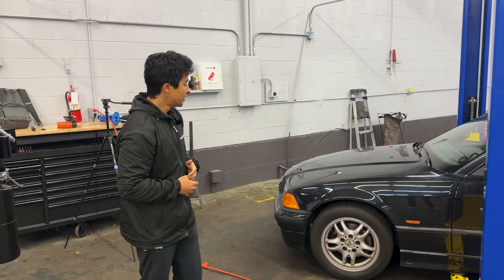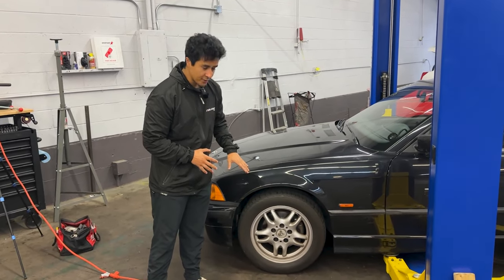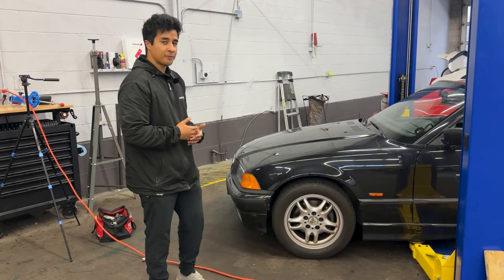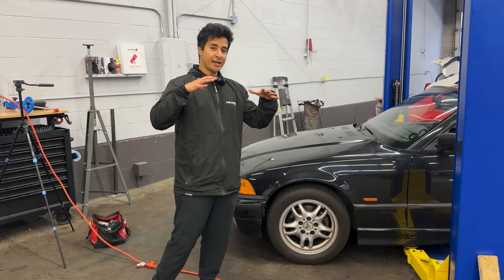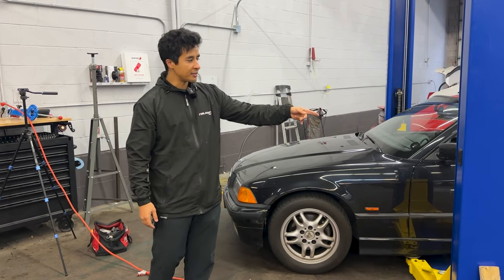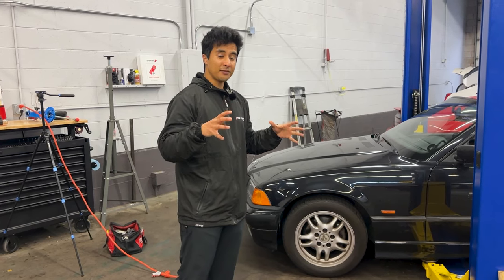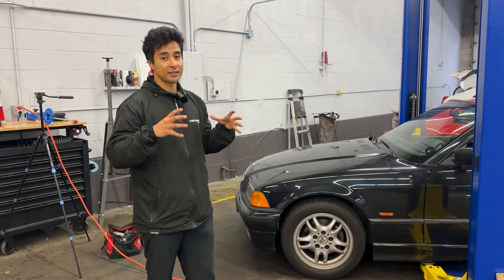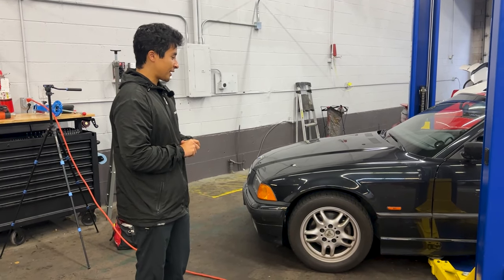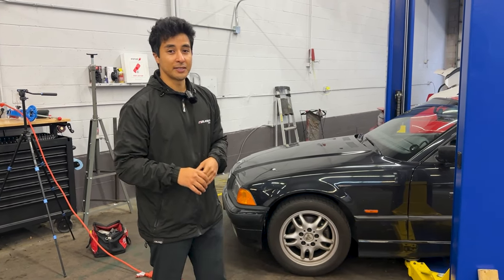In this case we'll tinker around with the fronts — I think I might be able to run a little bit of negative camber to get these to fit. This is really just an experimental way for us to dial in the fitment. We're only bumping up from a 16-inch to a 17-inch wheel so it shouldn't look too terribly different, but once we get this wider setup sitting right it's going to be very fun to take to the track. Of course I don't want to rub the fenders off completely, especially with the brand new tires — that would be really terrible.